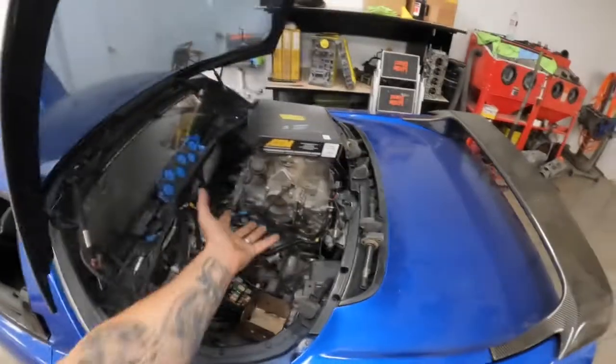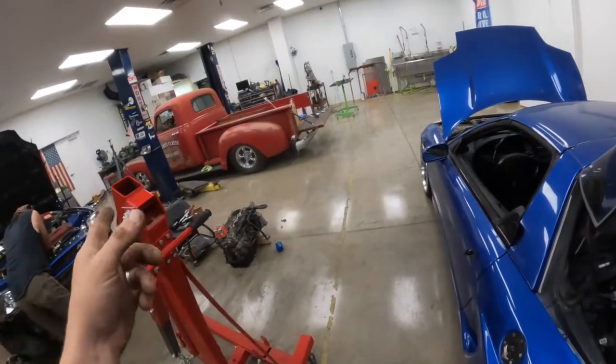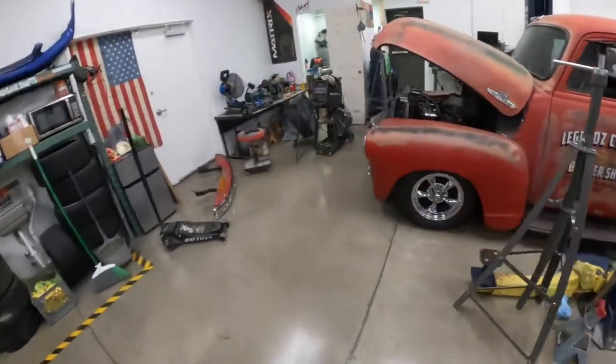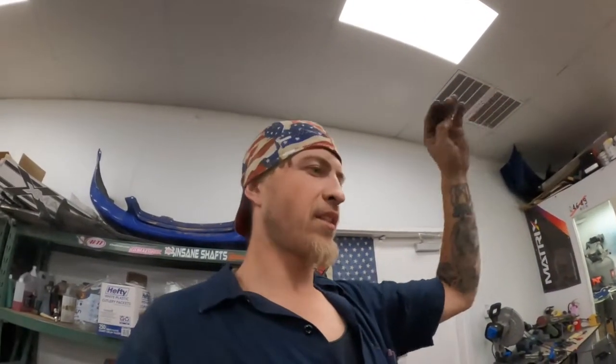While that's charging, I'm going to get back over here and pull all the supercharger off and pull all the wiring back out. I'm most likely going to pull Nacho's truck completely off the lift and get the NSX on the lift — the truck's done other than springs. I have to order two springs for the front. I made a mistake — I cut the springs: I had 14 inches from the top of the pocket in the frame to the bottom of the control arm pushed all the way down, so I gave myself 17 off of the 20-inch spring. But then I lowered everything about four inches, and I should have only taken two inches instead of three. I need an extra inch to be able to steer this truck all the way — right now I can only get about three-quarter steer. So we're going to get the right springs on the front and then this thing will be stiffened up and not riding like a Cadillac.